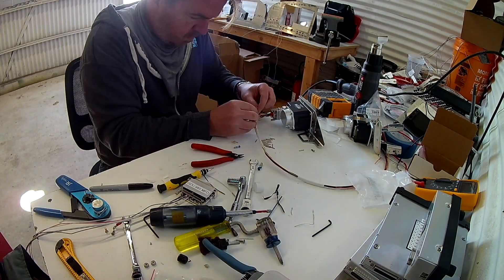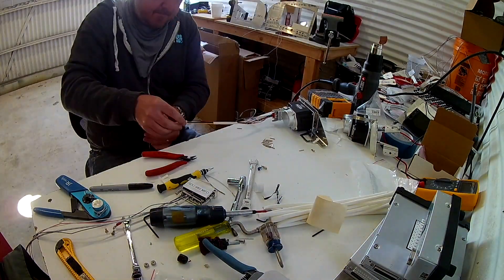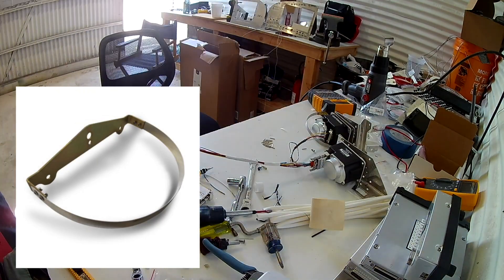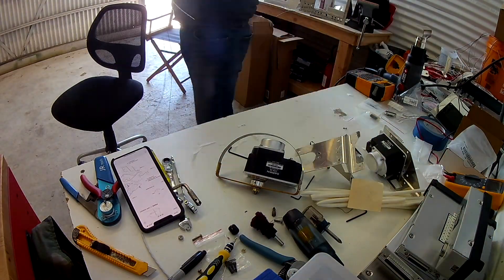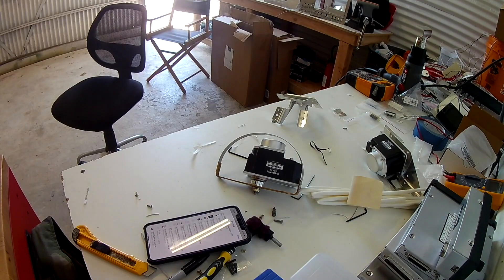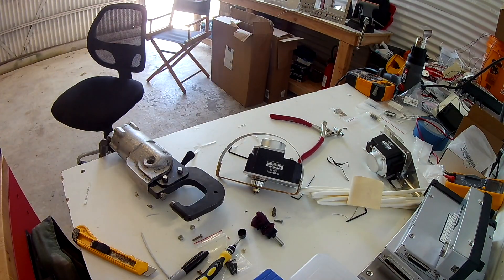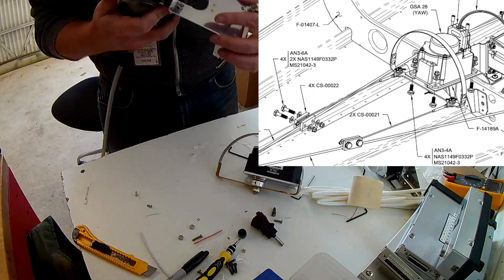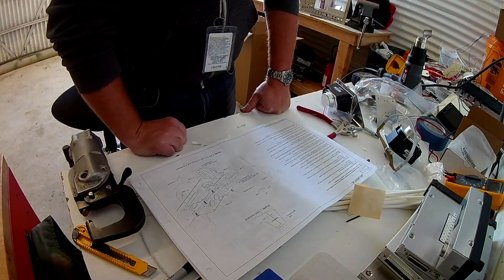It's time for a small rant against the man. You're about to see the yaw servo. Here's the thing about that arm — it attaches to the yaw servo. The way the yaw dampener works is that the servo has two cables connected directly to the rudder cables, and it pulls them back and forth based on whether you need a little left or right rudder. Simple enough.